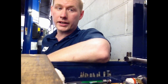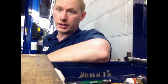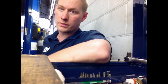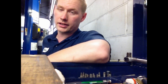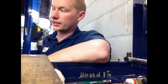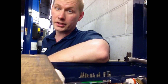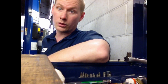For any kind of ABS concern, all you've got to do is drive it. If you fixed it, at 10 miles per hour or above it'll read it and self-clear itself. Pull it out and go for a drive. After that 10 miles per hour mark, it's going to see a valid signal from all the sensors and it'll just kill that light all by itself — no scan tools, no disconnecting the battery. You just saved yourself at least $250 to $260 doing this yourself, and it's very simple with no special tools, right in your garage or driveway.